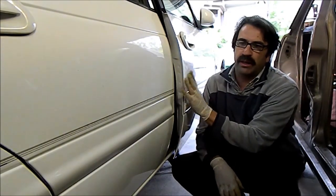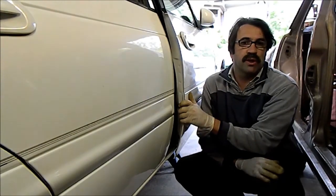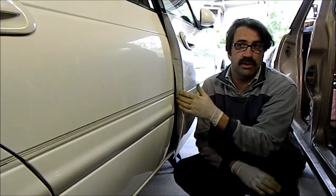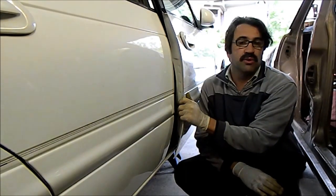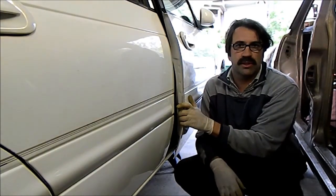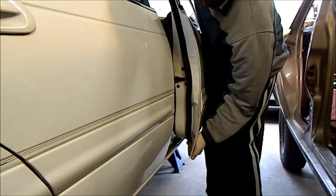Another thing to check on these old Fords, particularly if they've got a few Ks on them, is how the hinges are going. Quite often they drop down and there's excess play in them. Now this has got 240 odd thousand Ks on it, which is no big deal if it's a country car, and I know it was sold in Shepparton, so it probably stayed a good deal of its time there, but if it was 240,000 city Ks where people are getting in and out all the time, it could be an issue. So we just grab it and lift the door, and that's pretty good.